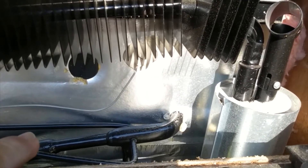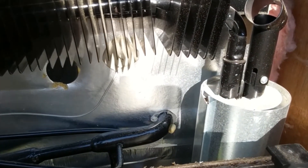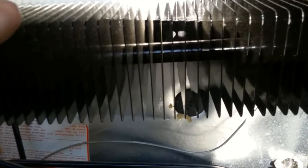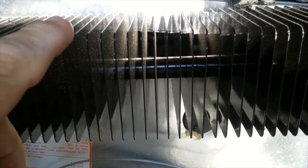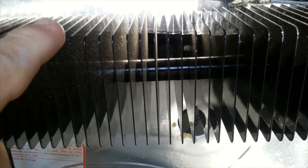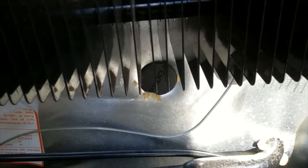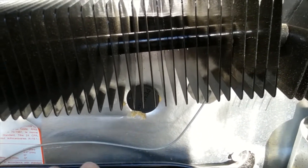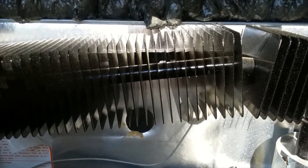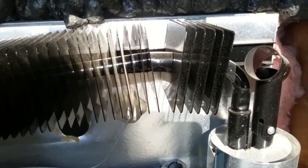The third thing to address is cleanliness. With the baffle in and everything sealed up and the fan running, you also need to make sure the area is clean — cobwebs will definitely mess up the refrigerator because they change the airflow through the coil. Keep it swept out and clean. The baffle and fan are mounted on the vent cover so that when the vent cover comes out, the baffle comes out too, leaving nothing in the way to clean and maintain the refrigerator.